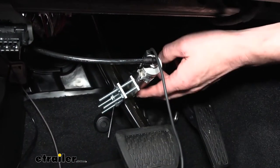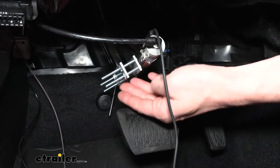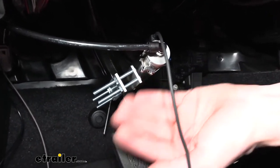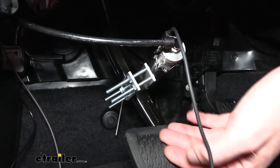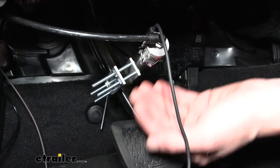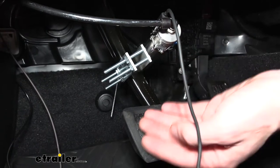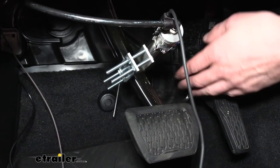The operating cylinder is mounted onto your brake pedal. You want to mount it high enough for your foot to clear to properly apply the pedal, but beyond that stay as low as you can — the lower it is, the more leverage you'll have for your pull and the better braking performance you'll get. Try to compromise between comfort and performance.